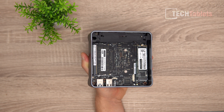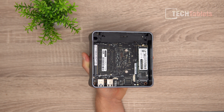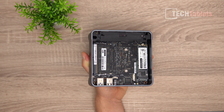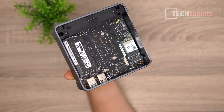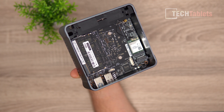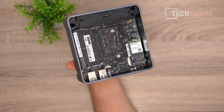There is just this single SODIMM installed with 16GB of RAM. Really, they should have gone with two 8GB sticks — a little more expensive for them, but that would give us dual-channel for much better memory bandwidth. As for the Wi-Fi card, if you want something better than what's included — which is Wi-Fi AC — you can swap in an Intel AX200 or AX201, which is Wi-Fi 6 with Bluetooth 5. That would be much better than what they have installed.